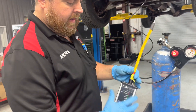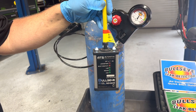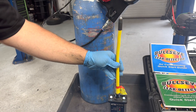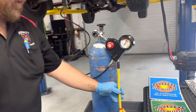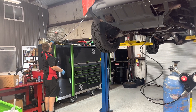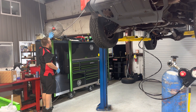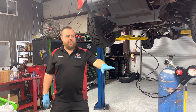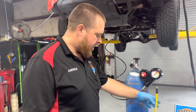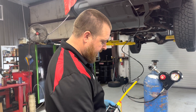Normally I would turn the sniffer on a little bit before this point — you want to allow it time to heat up, as there's a heating element in there. You also want to eliminate any crosswinds while you're doing this, because this sensor is very, very sensitive. You may have seen our other videos where we used it for AC leaks. It is a very sensitive tool, which makes it great — you can find very small leaks with it.